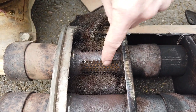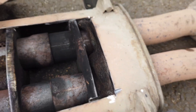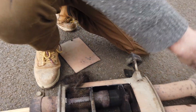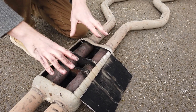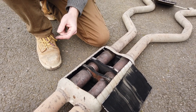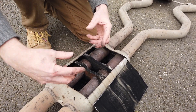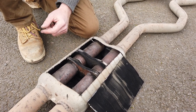So these two exhaust boxes are just a little expansion chamber with some wadding — probably the same on the other side. The other interesting thing is we were having a look on eBay at V8 exhausts for sale, and some of them have a sort of crisscross where the pipes meet. I was surprised not to see that on this exhaust. The F-Type has that same engine and it has an open cross so the two pipes mix — I think that does something with the tone.